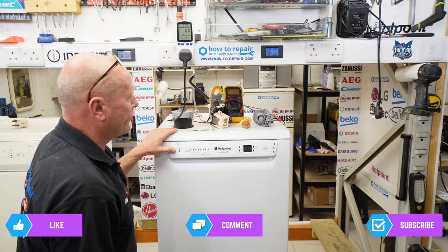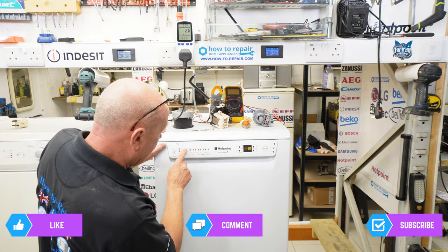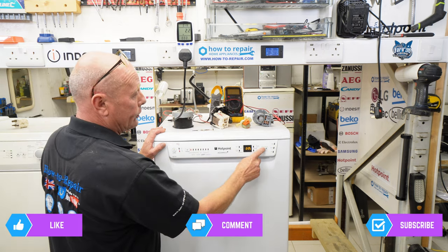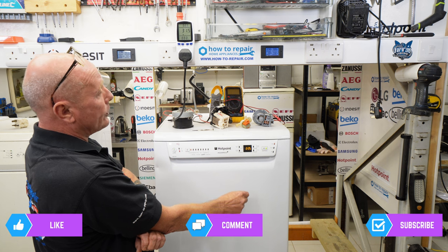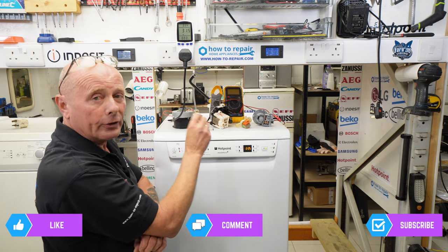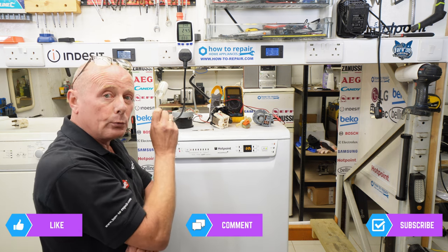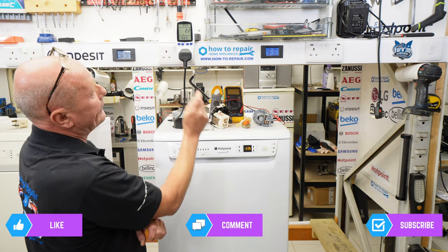I'm going to plug the machine in, turn it on — it may start emptying immediately. I've got it set to a super wash, which is two hours 25 minutes. Even on standby you can see this is drawing 2.2 watts. I press the start button and the pump comes on. The pump has load on it, so it's drawing just over 25 watts, plus any other components like sensors. As it empties, you see the wattage drop slightly because load has come off the motor — motors will fluctuate slightly on the power they draw. The machine has stopped emptying and we've gone back down to our baseline figure.